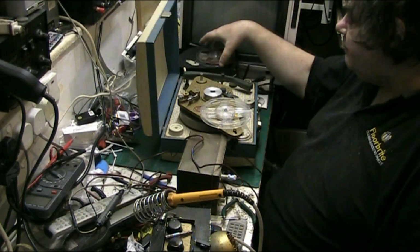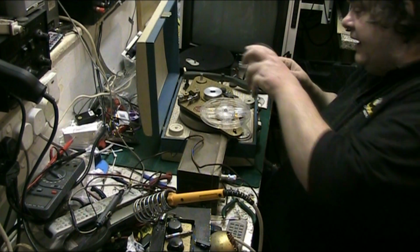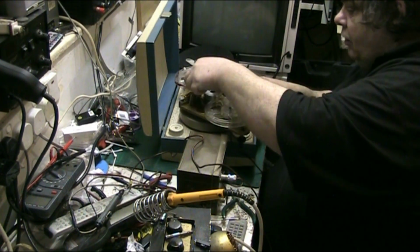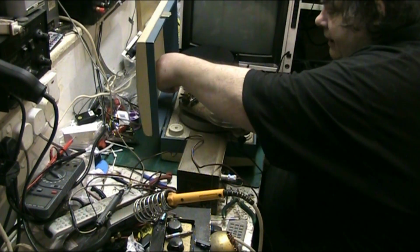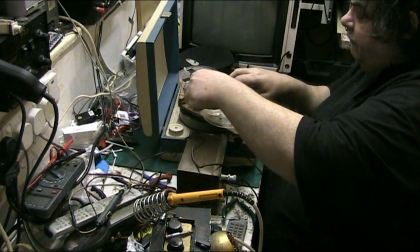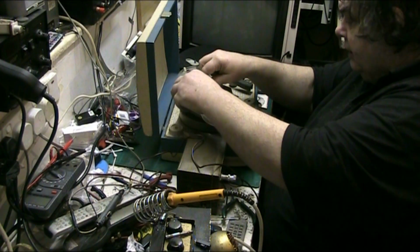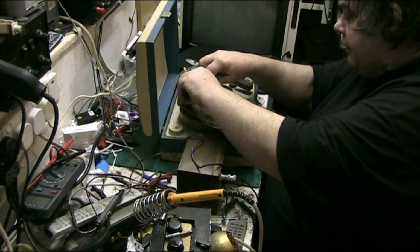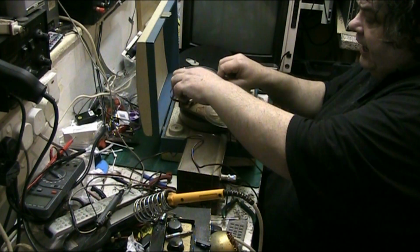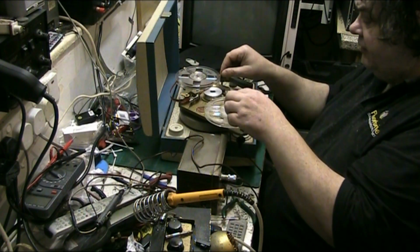To thread your tape, this is a 3.5 inch speed tape. So to thread your tape, you basically put your tape onto your Gramdeck mechanism. You pull it through, and for pre-recorded tapes, I always go around this tape guide here. That way I don't run the risk of erasing the tape. I'll explain that in a bit. Because this finger here turns on the erase head.